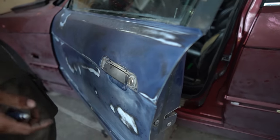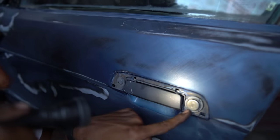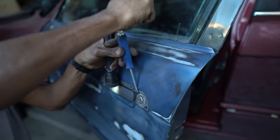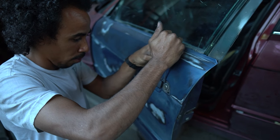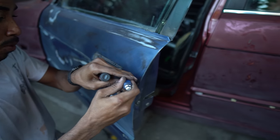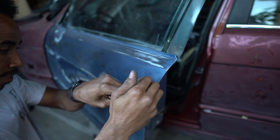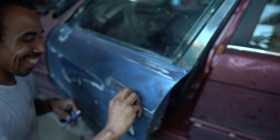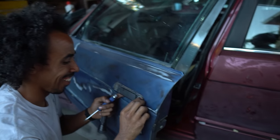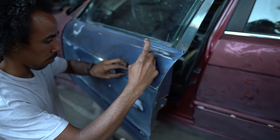After you do the trim is a good time to replace your door trim. But in our case we're removing the handle, so on the back side it's gonna be a 10mm on this side, and then this one is just like one of these special nuts that you just kind of hit loose. I don't know how people from the East Coast work on cars because those dudes do it in the cold. There's actually a special tool for that — it's a BMW, special tools for everything pretty much.